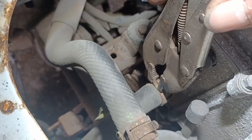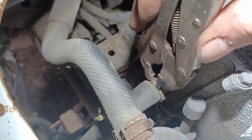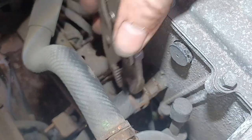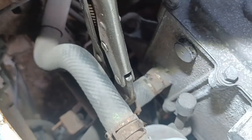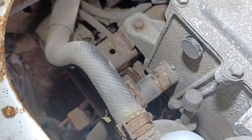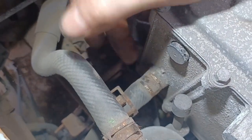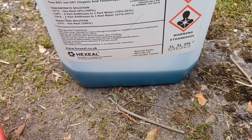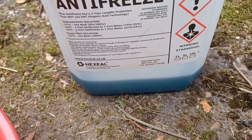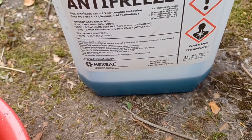The last coolant connection is on the side of the OBC. I've used my vice grips to get the C clips nice and loose. I'm just going to move those off the actual connection onto the hose and then release this rubber pipe from the unit. I'm not expecting any further fluid to come out.